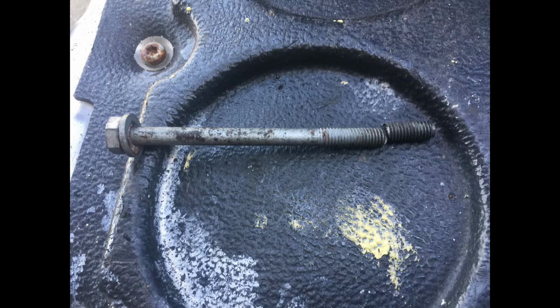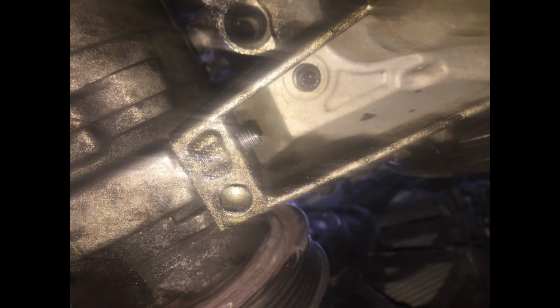So here can you see actually the lower AC bolt, which is way too long for some odd reason. Chrysler screwed up. So if you shorten it by roughly an inch on the threaded side, then here you can see it back installed. Then it just pokes through correctly and you don't have too much thread hanging inside. You don't really need it. But that gives you much more maneuverability with that bolt in order to remove your AC pump and don't have to fiddle too much around, because that's a big saver.